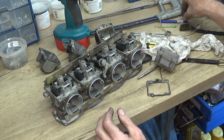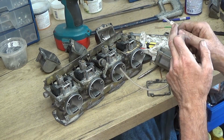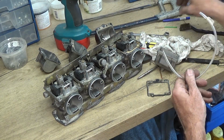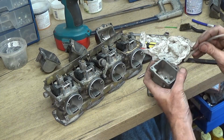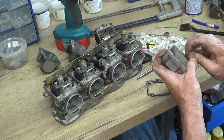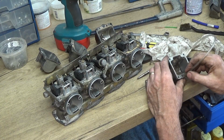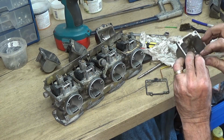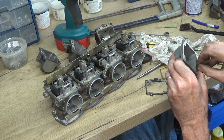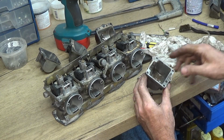now another piece of pipe. So these pieces of pipe got a tape on one end to remind us on which end to put in my mouth and which end is going to be covered in fuel. But if you put those down pipes like this, or over the top of that one, and blow down it, you can check that these are clear, or if they're blocked at all. So in here that's clear there.